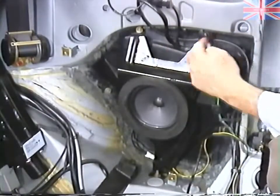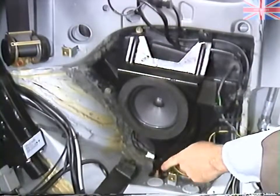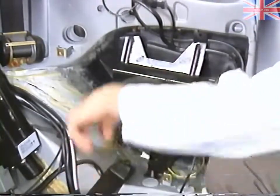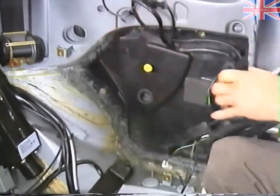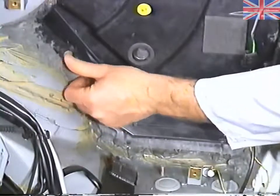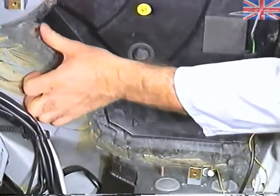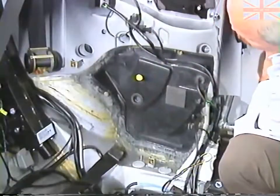The speaker is retained with two fasteners at the top and another at the bottom. Remove the pliable sealant from around the edges of the panel by using your finger — this will expose the panel and give you better access to the screws. Remember, when you replace the panel, replace the pliable sealant because this is an important corrosion protection material.